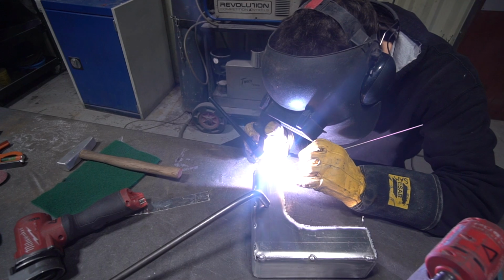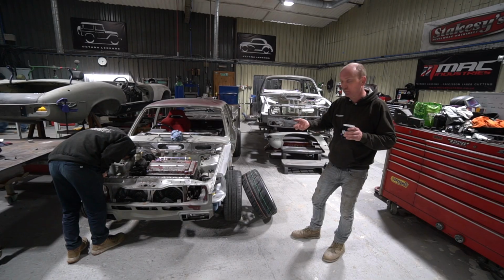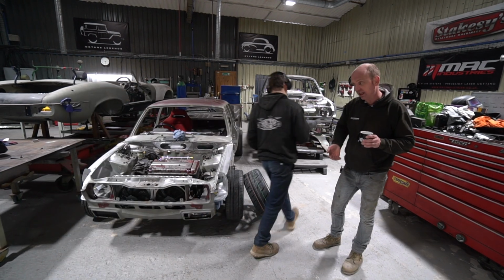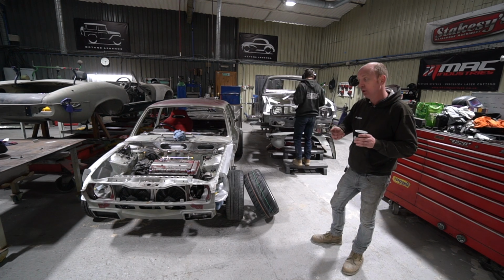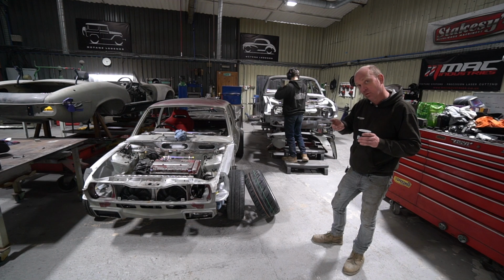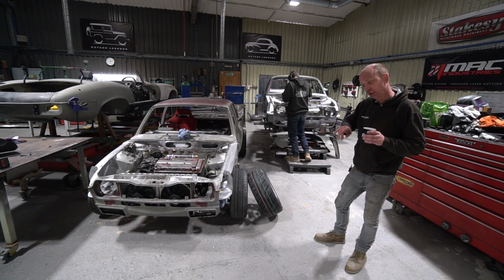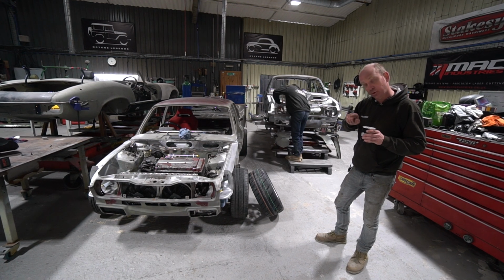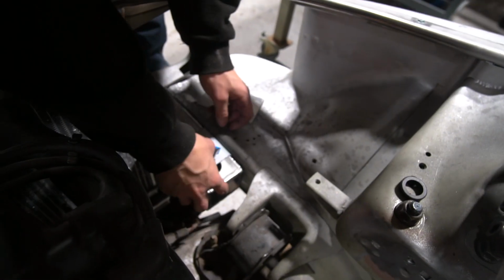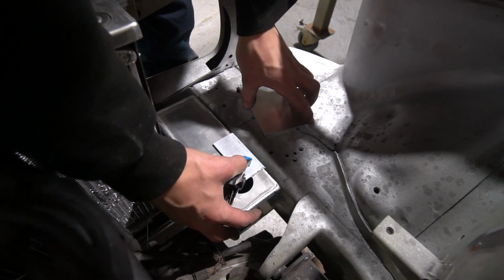If you fill the cooling system completely with water, it will expand and have to get out somewhere. So what you can either do is leave some airspace within the cooling system for that coolant to expand into, or do what the Japanese tend to do, which is fill the cooling system completely full of water, and then have a radiator cap that allows, as the water expands, it to expand out through the pressure relief cap, down a pipe that leads into the bottom of an external reservoir that isn't pressurised.